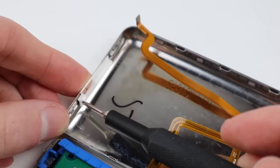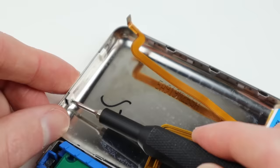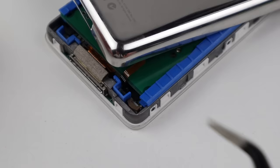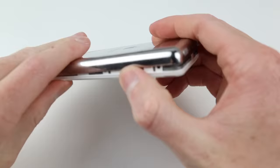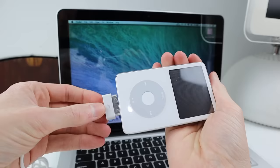With those installed, I can fix up the little dock surround port which I actually broke getting into the iPod. If you apply too much force around the dock connector, you're likely to break this as it's a very thin piece of plastic — however, they're only about a dollar on eBay so it wasn't a big deal. With the new one installed, I can now test out the iPod Classic. I'll make sure to connect the battery connector first, being very gentle as they are very fragile. I'm only going to press down the bottom portion of the iPod to allow us to plug in the 30-pin cable — it's a good idea to test the iPod before you put it all together.